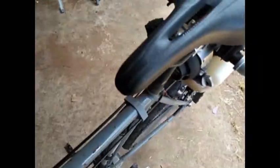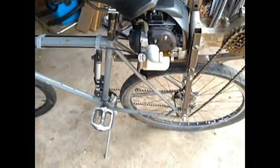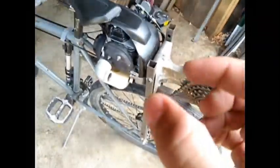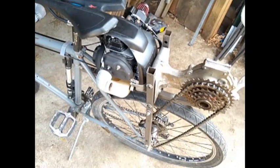The throttle is mounted up here on the handlebar — there's just a kind of adapter brake lever. The bike wants to move because the clutch is actually slightly worn, which kind of makes it kill the motor. The clutch spring needs to be replaced because I revved it when the transmission wasn't on, which you should never do because the clutch shoes swing out, it stretches the spring, and once the spring is stretched, that's pretty much it — you ruin the spring.